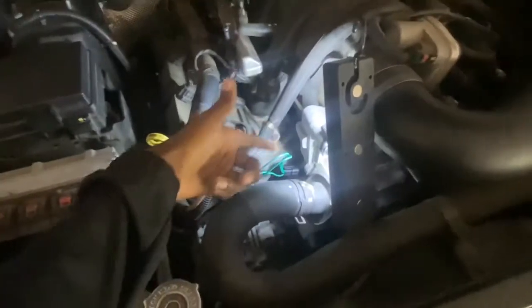So I'd check this first. I would go to the dealership to get my parts — I wouldn't go to AutoZone or any place like that. First, read the code and make sure it's the right code, because I was getting multiple codes from my aftermarket air intake and other things. Then change out the sensors, and check the wiring. My wiring was the issue. This seems to be a common issue on the 2012 Jeep Grand Cherokee, so I would start here.